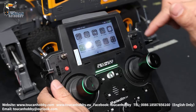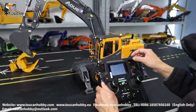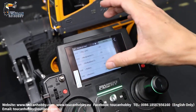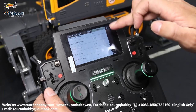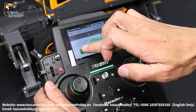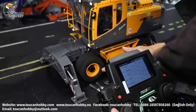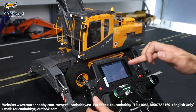For the reverse — for different control of the arm bucket, you can change and reverse it here. What's important is the end points. First is the trim — let's see the sub-trim. For everything here it is zero percent. Only the steering is ten percent. So at ten percent, you adjust maybe less, near zero percent, it will be straight. That's for adjusting the middle points — sub-trim. Others are zero.